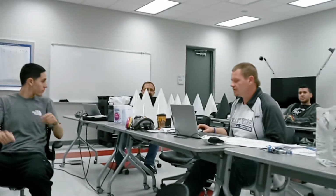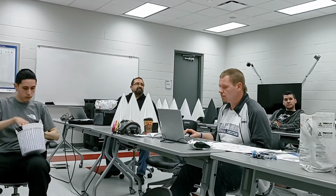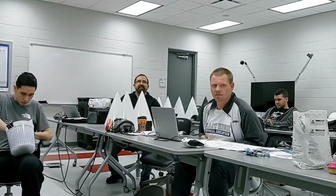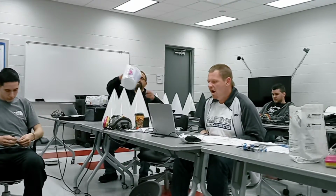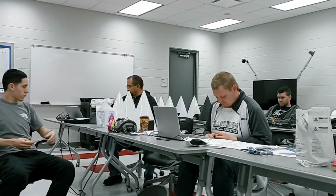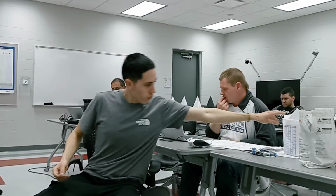That's after you mix it, right? Yep, after you mix it is the pot life. The amount of time it's sprayable. And then how long it can stay, how long it's good for, is shelf life. How long it sits on the shelf unopened in its original container is its shelf life. Oh, okay. Its pot life is the amount of time that it is sprayable from mixing. Okay.